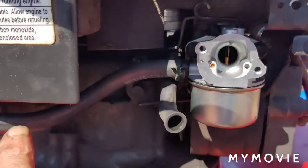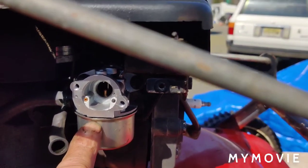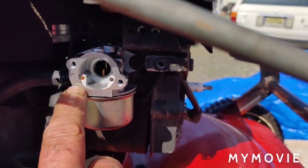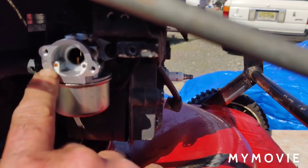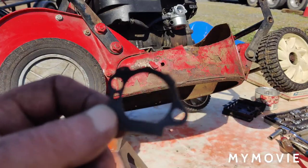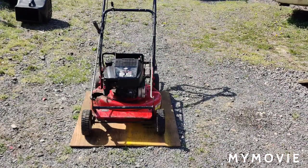We're looking good so far. I installed the new fuel line with gas still in the tank, put the main jet bowl bolt back in, and mounted the carburetor. We're checking to make sure there are no leaks - so far so good. Next I have to try to save that air filter base gasket off the old carburetor and get it off in one piece to reuse. Somehow I was able to get the air filter box backing gasket off in one piece. Let's try it and see what happens - I just have to keep my face away from the opening since I didn't put the tube back on.